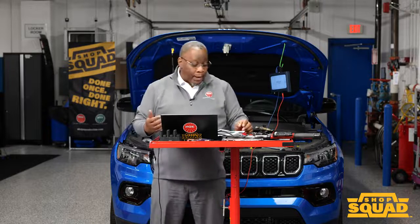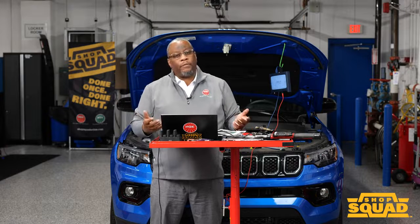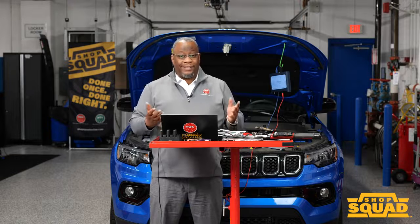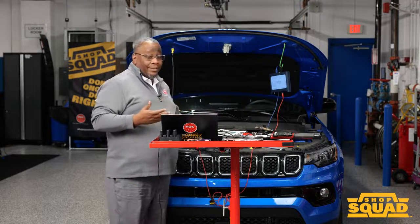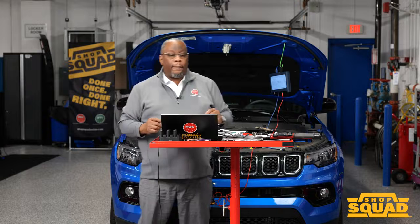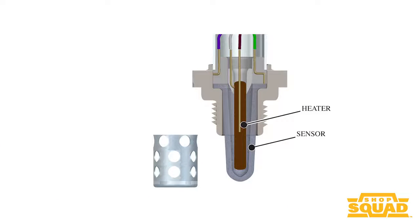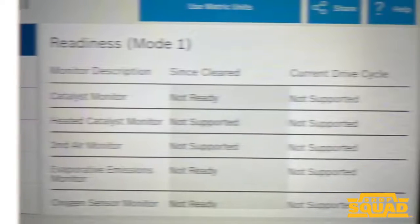Welcome to NTK Tech Talk. We're going to talk about oxygen sensors. When trying to diagnose oxygen sensors or air-fuel ratio sensors, part of the diagnostic process requires accessing the sensor and its wiring harness. With your regular four-wire heated oxygen sensor, the heater circuit must be verified first — without it operating fully to bring the sensor up to temperature, everything else is irrelevant.